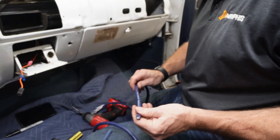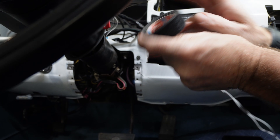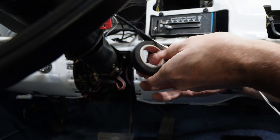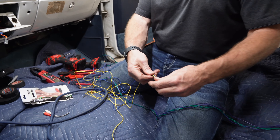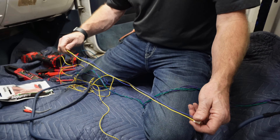So you're using something that I'm not real familiar with — I've never seen this. What is it? This is like a nine conductor loomed wire. Basically it's speaker leads and a turn on, or whatever you want to use it for. But I like these because they are color coded to most aftermarket radios. So I know where to run, what to run. So we're going to strip all this — I am because I don't need everything to each location, but I get my speaker leads and I get color coded.